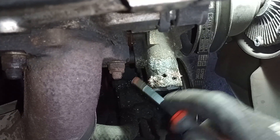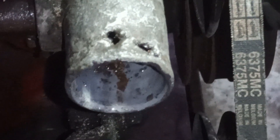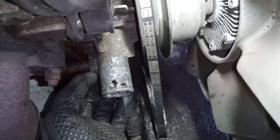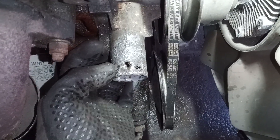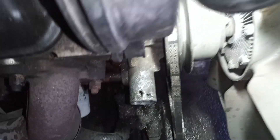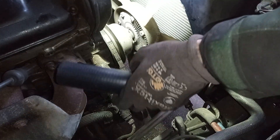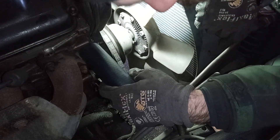Look what I found — holes in this. Look where it's corroded through. So we need a water pump. It's just those two holes on the top; the rest of it is kind of okay. I think if the hose goes right up to this point it can't go further — we've got a good centimeter and a half, couple of centimeters where the clamp can sit, so it doesn't matter too much for now. Obviously we need to replace the water pump, but I don't want to do that today. I'm glad we did this so we found these issues — a blown thermostat and a corroded water pump.